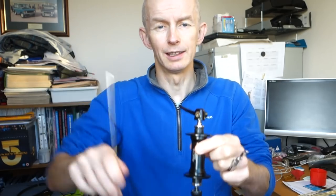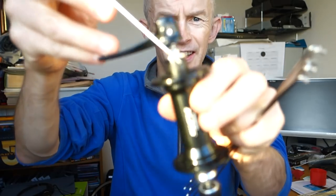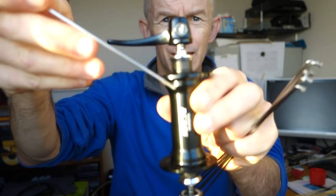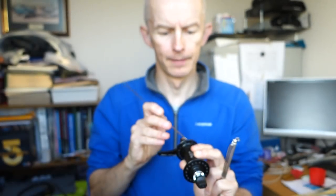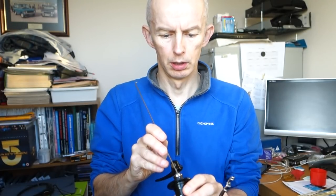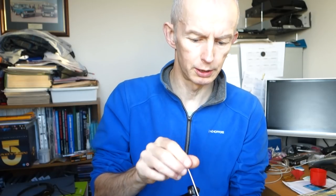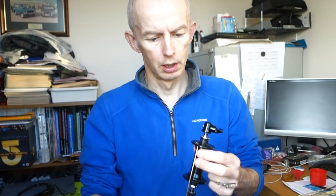And we're going to put them in first. So we're going to put the innies in first. Find the logo hole here. So the logo's there. Come up, find the hole near that, and I'm going to count three left. So, one, two, three, and I'm going to drop my spoke. So that's my first spoke, that's my key spoke, that's the important one. And there's another key one on the other side.